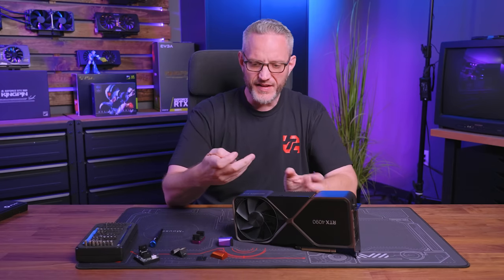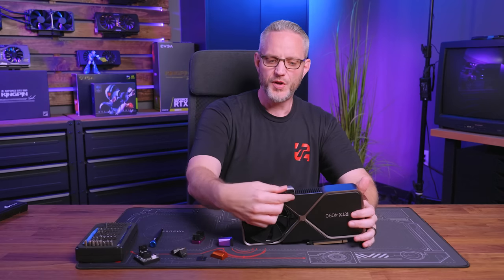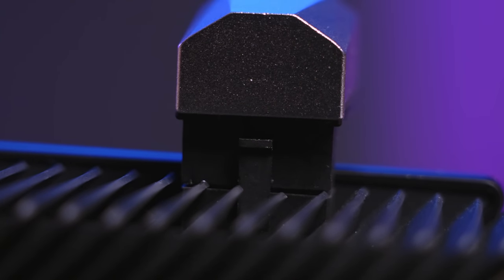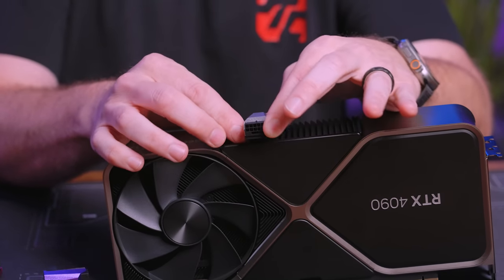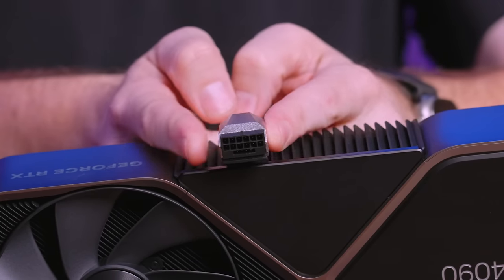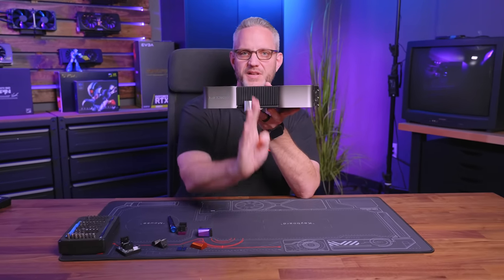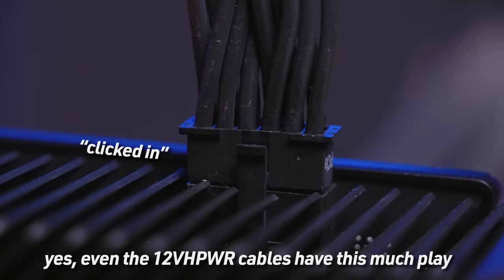Even up to a 4090, I still 100% stand by the adapter. The reality is you can burn your 4090 using any regular cable or adapter. You might have a higher probability with the adapter because of the extra girth of the cable giving more torque to twist it. Once it's plugged in it is seated and solid, but as soon as you start moving it around to manage your cables, this is the amount of wiggle you have — it's being held on just by the tab. Both people are right: the manufacturer is right that it's crooked, and the end user is right that it was seated because it clicked. It might not be obvious looking head-on that it's off-axis, but you cannot rely on the click alone to confirm it's fully seated.